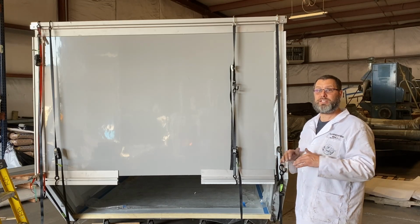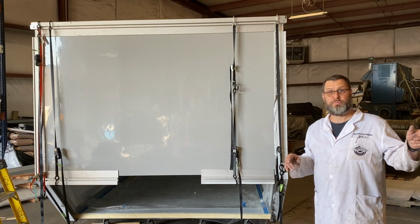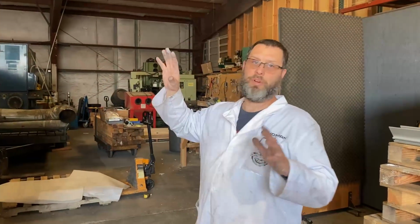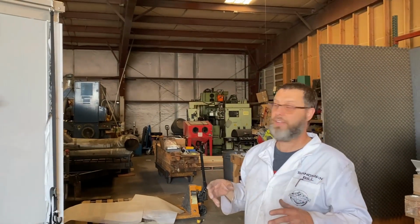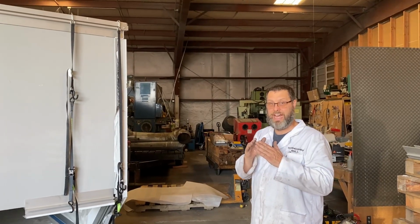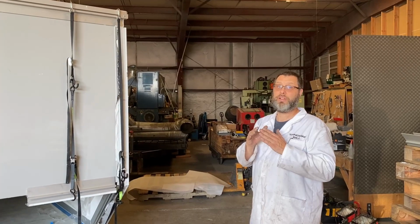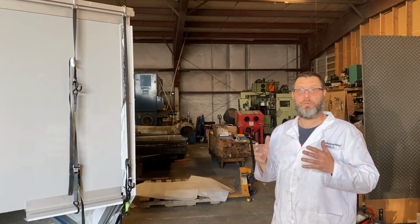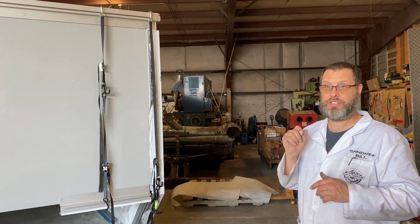Once it's all in place, it'll be in position. With the approach angle wall, we're going to do some drilling and fabrication. We'll show you here in just a second. Now's also a good time, while you're sitting, to start cleaning up your excess joints that oozed out. You want it to ooze out. It's not a bad thing to have a little bit of a gap for your Sikaflex, because Sikaflex likes a little gap, not no gap. If there's no gap anywhere, you actually have a weaker joint than if you have a little bit of a gap and put Sikaflex in there to bond the surfaces together.